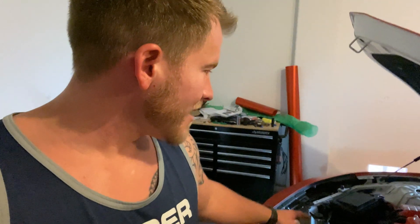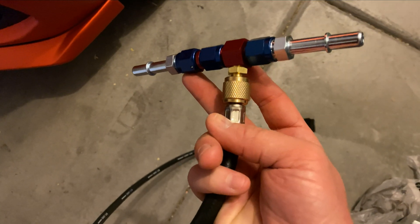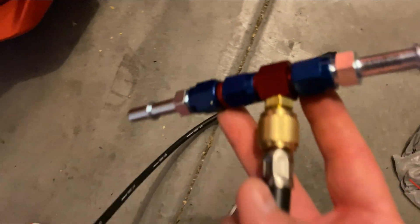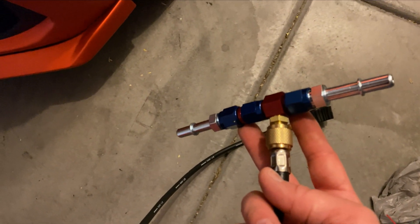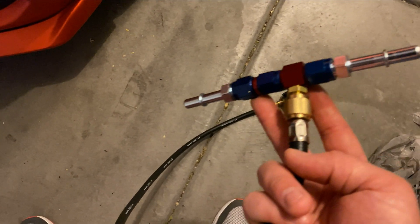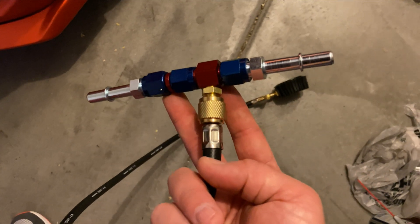I don't think I bled the coolant system properly, so I'm going to try to let it cool down and do that. There's just something going on with that low-side fuel making things wonky. So I'm just going through the data back and forth with the tuner trying to figure out what's going on. I searched everywhere on the internet to use a mechanical fuel pressure tester — there's nowhere that says how to tap in to test fuel pressure without using any sensors, just in case one of those are wrong.